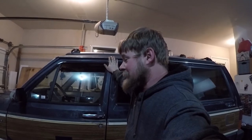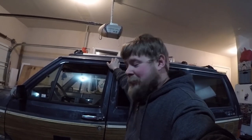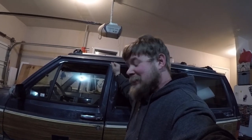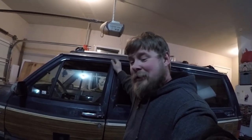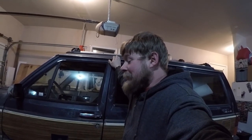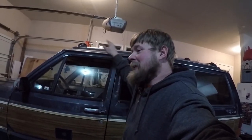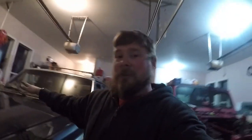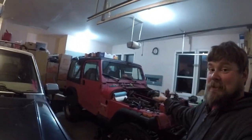But we're gonna get down to the coast, get some gears on this thing so it stops driving 100 at 1800 RPM, where the Jeep's not happy to run and happens to boil the transmission fluid over when you're towing. So it's going to 4.10 gears. We still haven't quite made a decision on lockers or limited slip, but the guy said he'll show us a few things down there and we'll make that decision when we get down there. We definitely are going to time lapse that, so stick around for that one. And then after that, we're ordering our parts list. Should cost us about $800 for the parts we need for this. So this is the next step up.